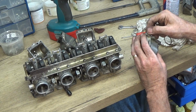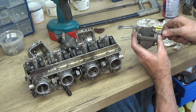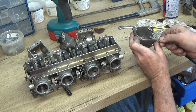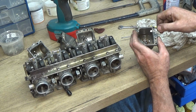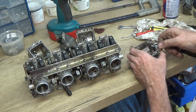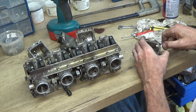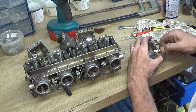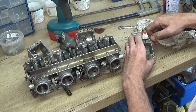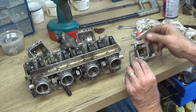And so to get the gaskets up, if you can get one that's up a little bit, just use a feeler gauge, fairly thin, and just go around and try prising it up, then it should come up. Got to be very careful, we don't want to split these. Seems to be coming though. Right, that's it. So we'll need to clean this gasket off.